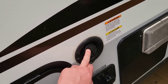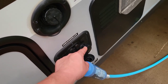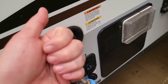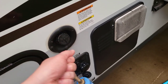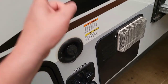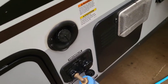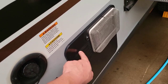This port here is for winterization. This is where I would hook a hose tube, put it in a bucket full of antifreeze, turn my pump on, and run the antifreeze through my lines. Once I go to each faucet — kitchen sink, bathroom sink, shower, toilet — open it and get a little bit of pink out of both sides, then I turn my pump off and I'm winterized. Just make sure you close the valves before you do that.